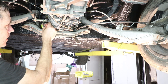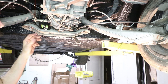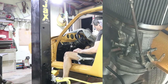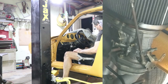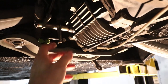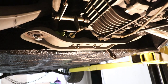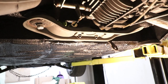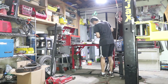That way I can try it first and then cut the actual rod. So this coupler is a little too far towards the rear of the car, but that's only because this rod's too short. Let's just see how the gas pedal operates. None of the ball sockets came off — what ended up happening is the sleeve that I made for the new rod, I forgot it wasn't welded, so it just came disconnected. But everything else felt pretty good. So I'm going to measure the length that I shortened this all-thread and shorten the tunnel rod the same amount, and hopefully that's going to give us enough room for adjustment.